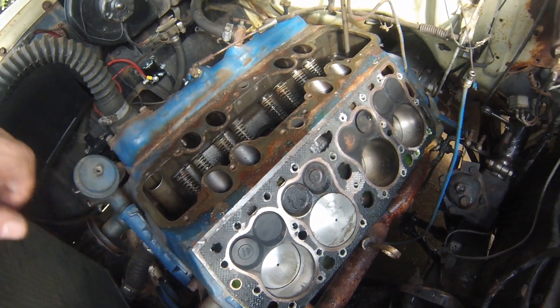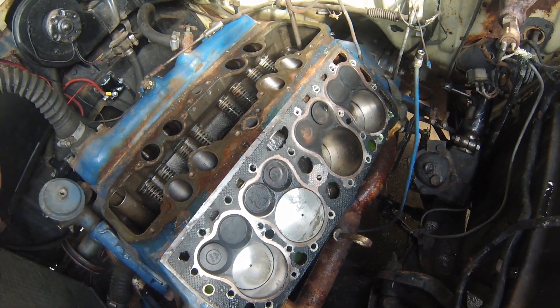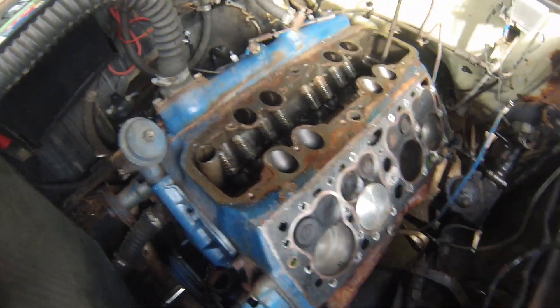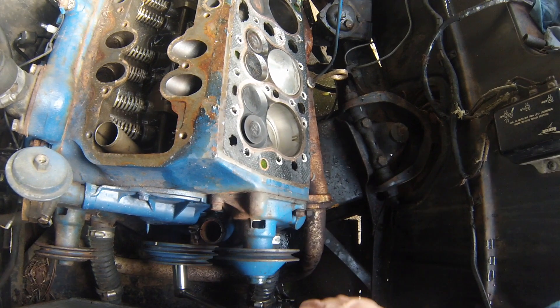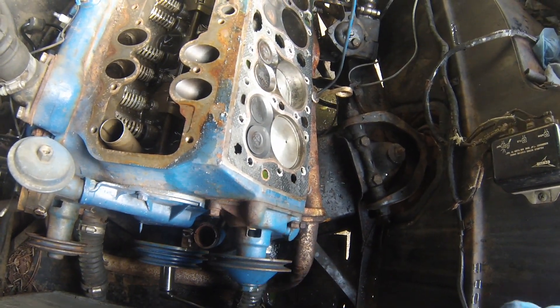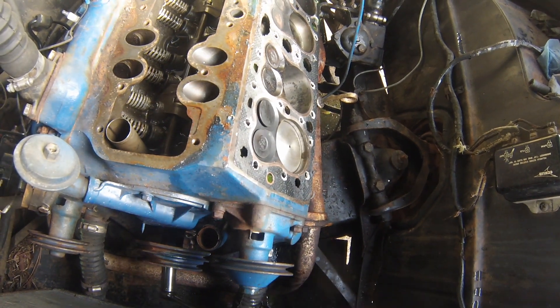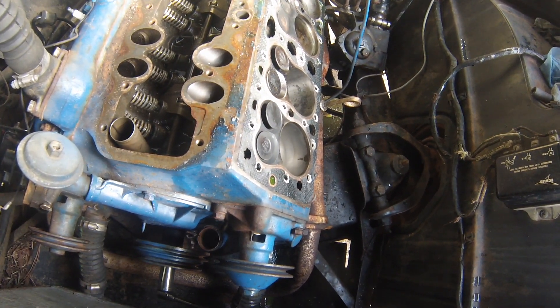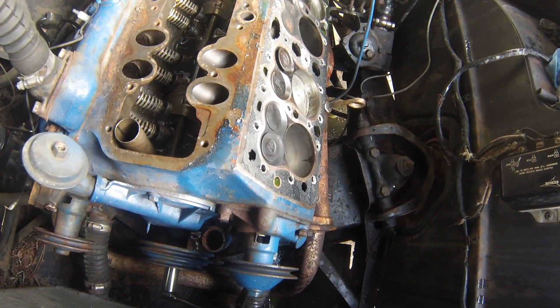As you can see, this valve here — it looks like maybe an original valve, it's got 'Ford' on it. The intake is smooth. Let me do the spinny spin if I can hold the camera still. You can see the valve goes like that... and it almost closes. Then the intake opens up. So the exhaust valve is hanging open — the intake is closing all the way no problem, but the exhaust valve is in bad shape on that one.